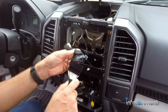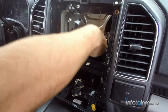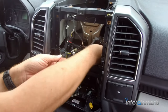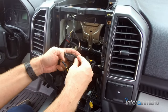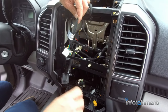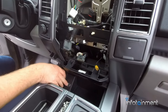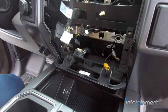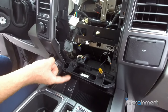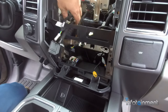We're going to go ahead and plug our main SYNC 3 connector into here and lock that lever into place. The other little cables attached to it will not be used — you can just zip-tie them back. This connector will be the one that plugs into the SYNC 3 module, and now we just need to route this to our newly installed hub. This particular vehicle has a center console, so we need to gain access to the existing hub, remove it, and route the cable to here. If you don't have a center console, you'll notice the hub just lower than this — same process. You can reach down, pop the hub out, and install the replacement.